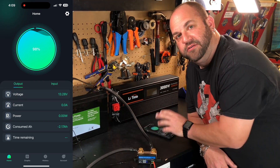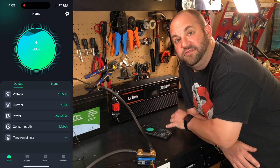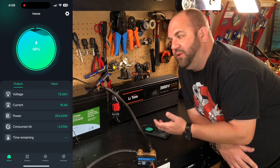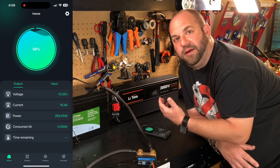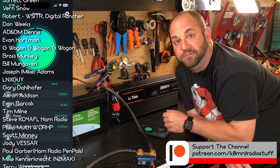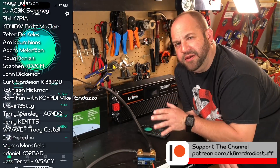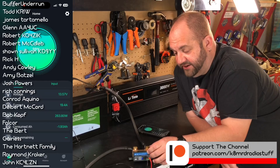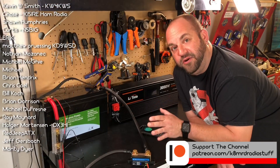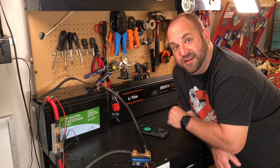Now I've hooked up a 20 amp charger to show what happens. We've got 19.5 amps coming in and the consumed amp hours is going down. With solar specifically — what I'd use this for — I know I've got a 100 amp hour battery. Even with a load on, if solar is going in it monitors what's going in and what's going out, and once fully charged it'll be back to zero. This is awesome — 70 bucks versus about 150 for the Victron shunt, and the app is a spitting image of it. I've been using it for a couple weeks and I'm really happy with it. I'll leave an affiliate link in the description — thanks for watching Ham Radio Tube, 73.